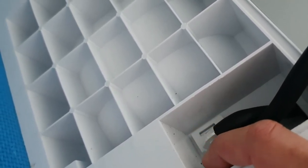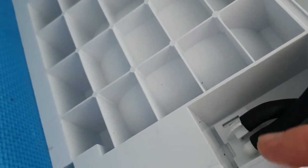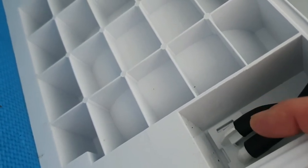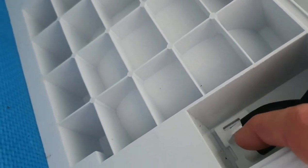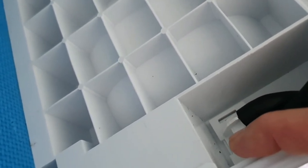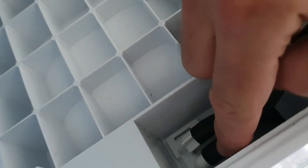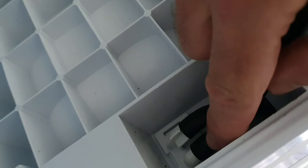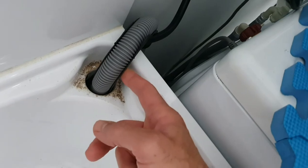Mind you, that plastic that attaches it to the dryer is designed to come out, so if it pops out, be gentle with it. It's easier to work with when it's out, but don't pull it too far because you can pull the pipe from the compressor itself. One side is connected to go up; the other side inside the dryer goes straight into the mechanism that drains the water from your drying. So just to recap: take the pipe that was mounted in the middle, take the drain pipe that came with your kit, mount it here, run it all the way up, hook it, bring it down, and back to the drain where you drain your washing machine.